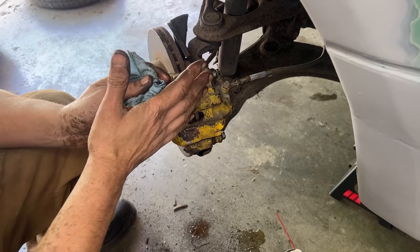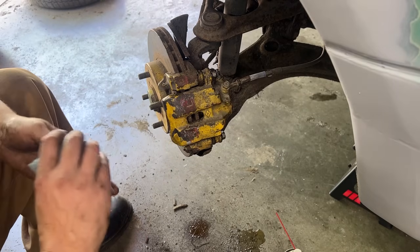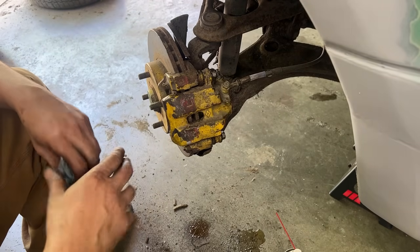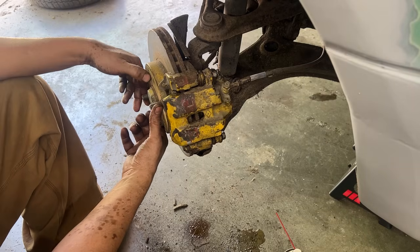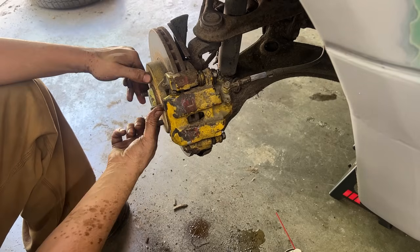The piston is gonna move a little bit, and then you have to let go and pump again, and pump again. So that's dangerous. So always when you change brake pads, sit down and pump a few times. So do it now. Let go now? Okay. Press it.